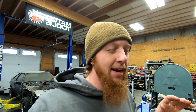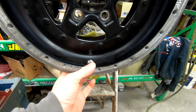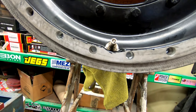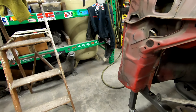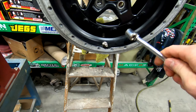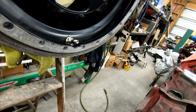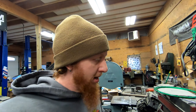A little bit of grinding and a few coats of paint, and the wheel now accepts our new valve stem. It didn't take that crazy of a notch to achieve the space needed to accommodate our air chuck. We have plenty of clearance all around, both with the bare wheel and with the beadlock ring on. So this wheel is squared away on this front and we can move on to actually getting the tire mounted onto the wheel.